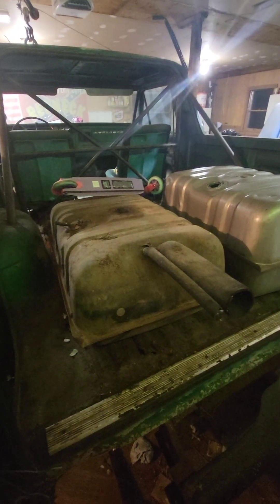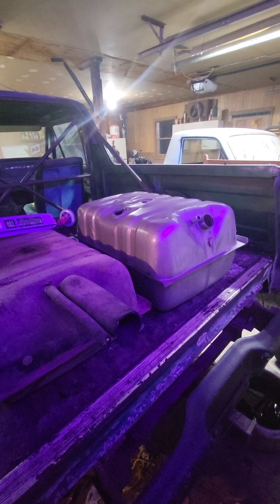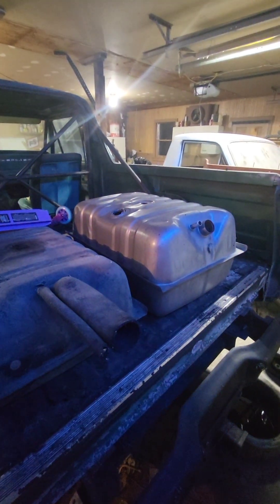Tonight I got the fuel tank out the rest of the way. The new fuel tank is ready — I need to buy a sending unit and a roll of fuel line. The next step is to get fuel line and the sending unit ordered this week. Then I'd like to get some fuel in the temporary tank, pull it outside on jack stands or ramps, get it higher in the air, and pressure wash underneath it better than last time — I washed it for an hour before bringing it in and it wasn't enough.